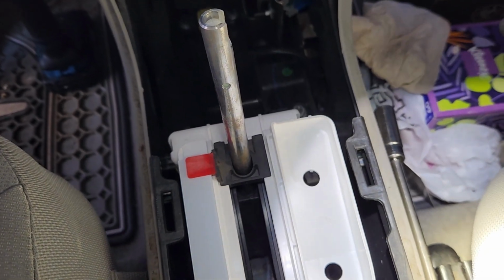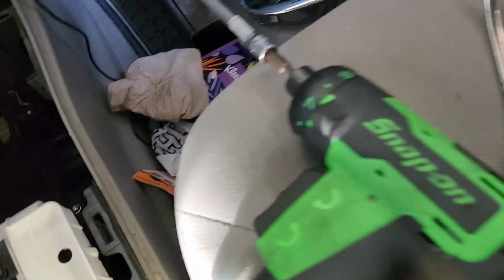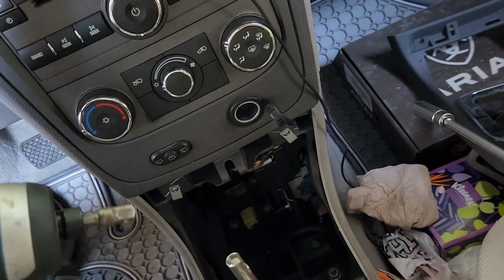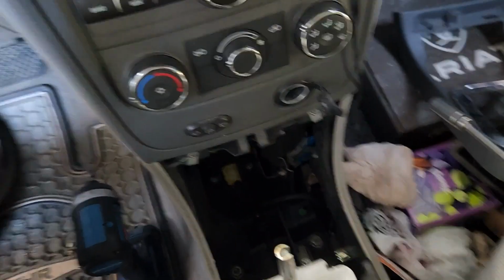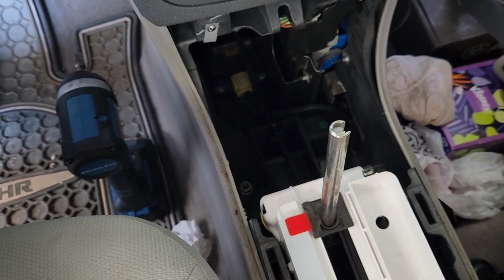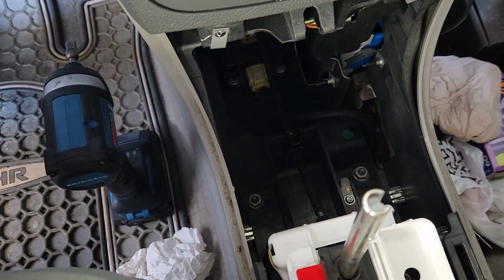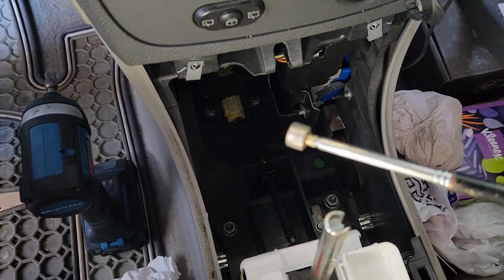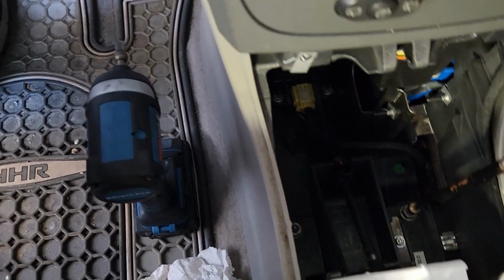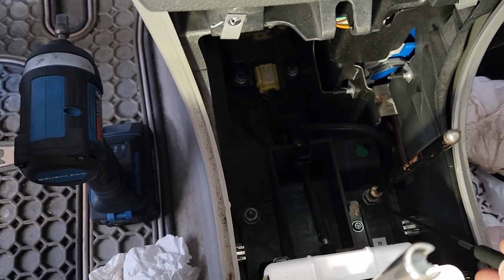Taking it out is a little bit of an issue because the bolts want to spin. I used a combination of a cordless driver and a cordless impact. The cordless impact is more important on putting it back together. Other problems you can have are that, like I said, these bolts will spin, and what I had to do was use a magnet on a stick to lift the bolt up, and then I could take an angle pick and slide it in beside it and lock it in place.